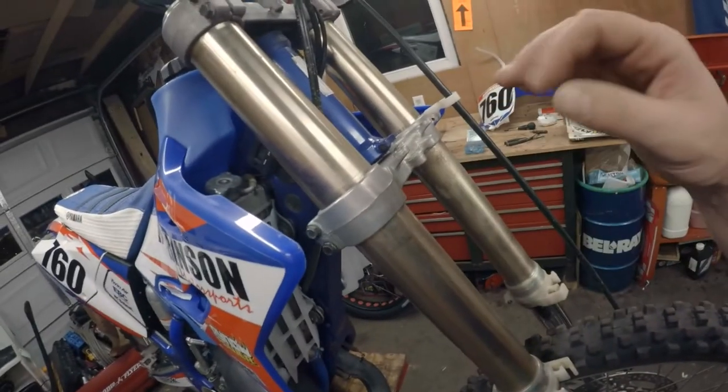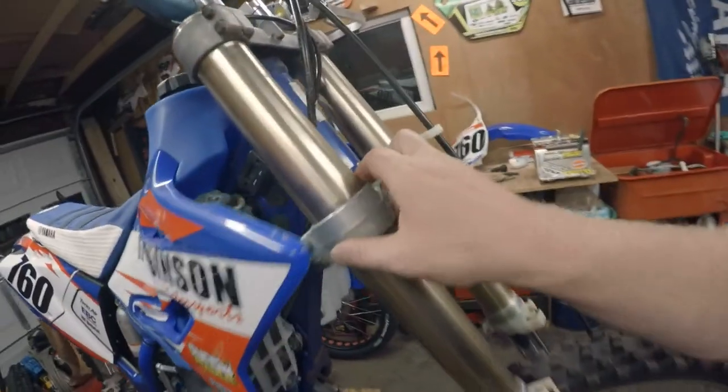You just need to make sure those are loose enough that you can put a wrench on them and spin the tube to get them off. It'll save you in the long run because maybe whoever's doing it doesn't have a triple that he can clamp and use as a wrench. You don't want to scar anything in these tube areas because you want them to clamp as tightly and effectively as possible — if they're scored up you're gonna have a bad time. The person doing the work will thank you.